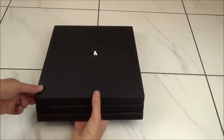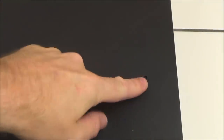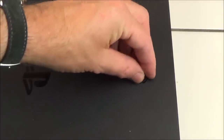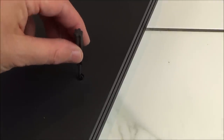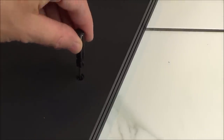To get a stuck disc out of your PlayStation 4 Pro, turn it upside down. Look at the circle on top of the P — that's a rubber foot you need to remove. Slide it out with your finger, pick it out, and inside there's a little protective plastic sheath you'll have to break through with your screwdriver. Underneath is a screw — put your screwdriver in, push through the plastic sheet, then turn it counterclockwise to eject the disc.